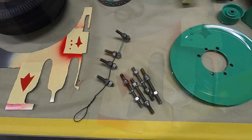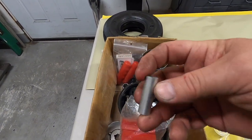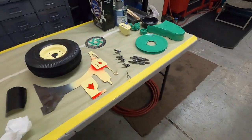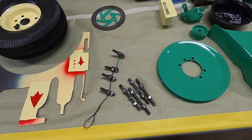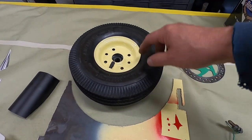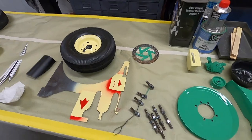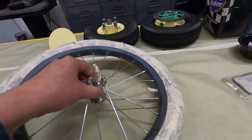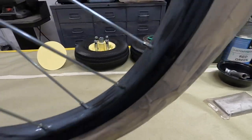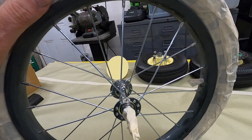I was just getting the bolts ready. I'm going to paint all the bolts flat black, and the sleeves are aluminum so they're just going to stay silver — it's hard to get paint to stick to aluminum. I'll just rattle-can the bolts with Rust-Oleum flat black so if you see them through the wheel they don't stand out. I sanded out the paint on the wheel too — that paint is really thin. I could easily take it down to bare metal. I sanded it out and wiped everything down with lacquer thinner.